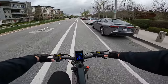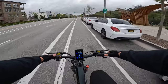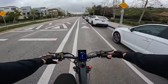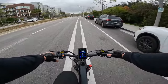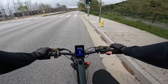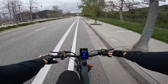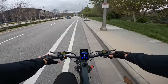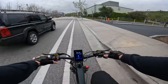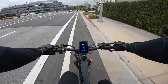I really love bikes that show a watt meter, and the display on this bike is genuinely nice — very visible and clearly readable. Pedal assist 3 gives about 400–450 watts up to 19 mph. The bike does have eight gears and not seven. Pedal assist 4 gives around 600 watts at 23 mph. Shifting up to gear eight makes a minor difference. Pedal assist 5 gives full max power, around 1,000 watts at 25 mph.